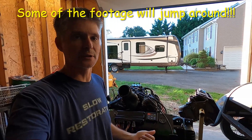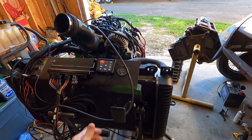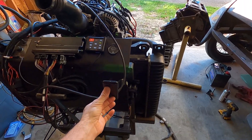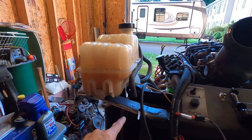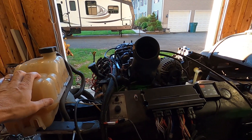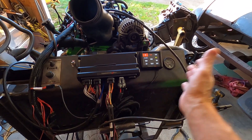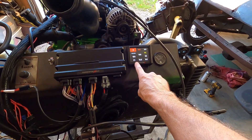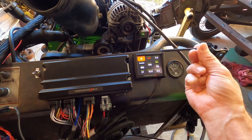As you can see, it does run and it sounds good — it just hasn't gone through and learned everything yet. We're still working the bugs out of this stand. We have our drive-by-wire pedal set up here, the radiator mounted with some welded brackets on either side, and a little bracket for the expansion tank. You can't get any simpler than this — I didn't go in with any tuning software beyond the Terminator X handheld. The easy way to navigate it is with the stylus.